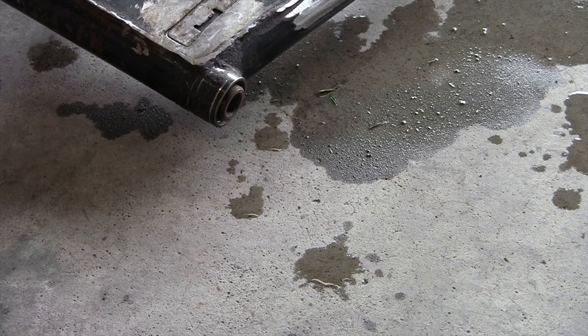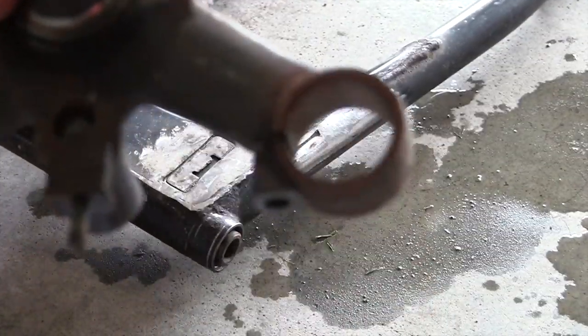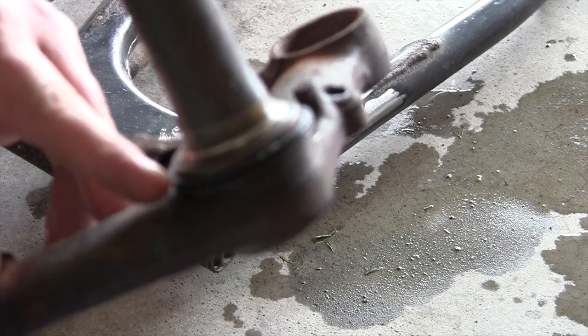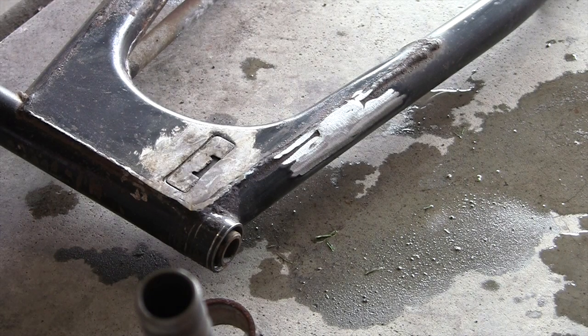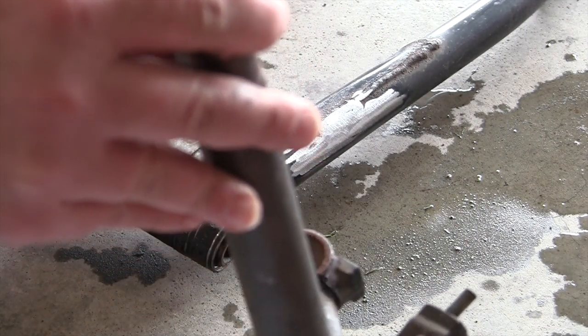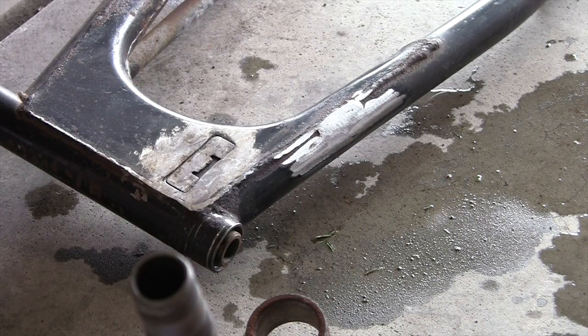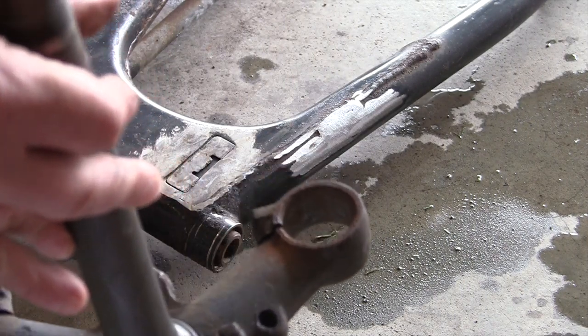We are back, it's about three minutes later. You can see we've got that all nice and rounded over — you'd never know it was there. Now the next thing I'm going to do — I don't know if you remember — I was talking about that little nub right there, this little nub right here being broken off and the other one good. There's the good one, there's the one that's broken. Since this is not going to be on a kickstand — it's going to be on a frame stand — my concern was when the bike was tilted on a kickstand it would hit the tank. Being on a frame stand, it's not as big of a concern for me. So instead of wasting the money or trying to modify this, I'm just going to grind them both off.